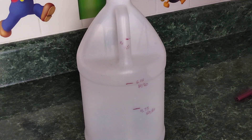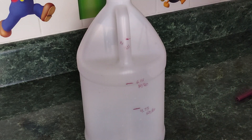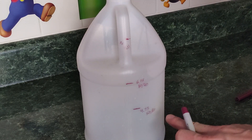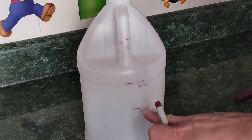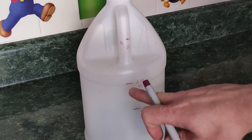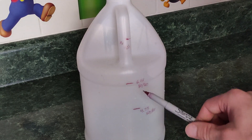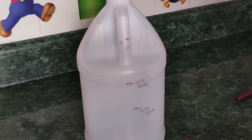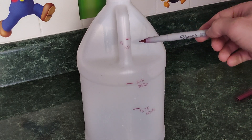The way this works: these measurements are taken on a level surface using this jug's geometry, even accounting for the tapers. All you do is, if you want 50-50, fill it to the 50-50 mark with methanol. If you want 80-20, fill it to the 80-20 mark with methanol. Once you've filled it with methanol to whichever mark you want, fill the remainder to the full mark with distilled water.